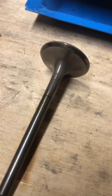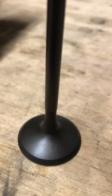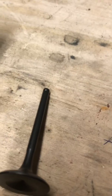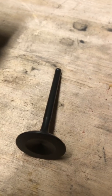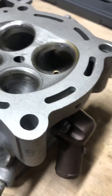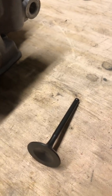Now one thing you'll notice is how fat that valve is down towards the head — but look at this valve. See how that's undercut? That's a stainless valve, and the reason they can get away with that is because the material is so much stronger — they can undercut it for increased flow. It weighs more and it's going to slow down your valve train a little, and you've got to have a heavier valve spring, but you will not break this valve. Period. There are guys with Kawasaki 450s and 250s who, when they rebuild their motors, are putting stainless steel valves into them. That's what this is — this is a conversion valve.